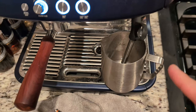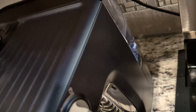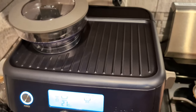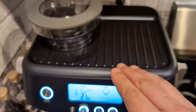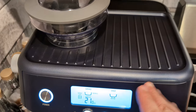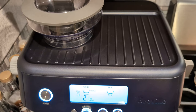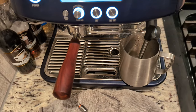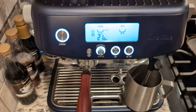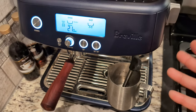If that is the issue, you're going to want to put half a cup of water and half a cup of white distilled vinegar in the tank. I highly, highly recommend taking out the filter. Where the filter goes, there's already kind of a little mesh to protect it. So you could just take it out, throw in the water and the vinegar, and then I would recommend running a full descale and a flush on it. You might need to add water just depending, because the machine might not run.